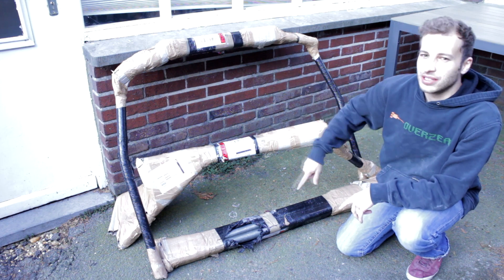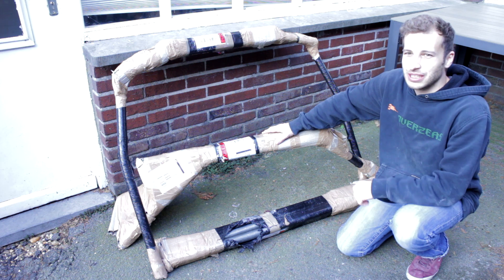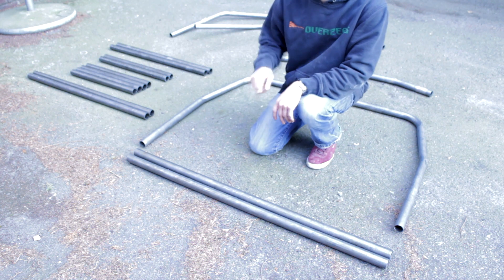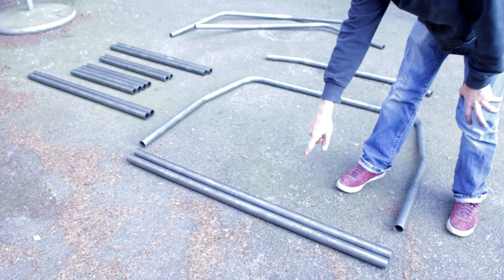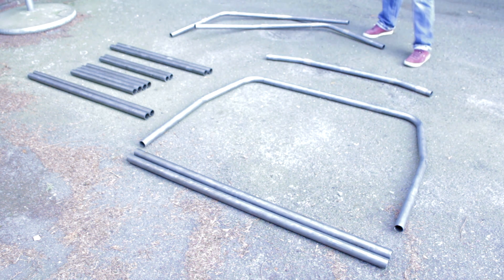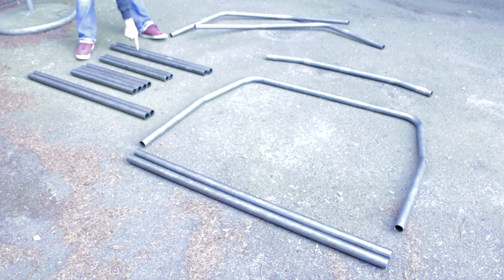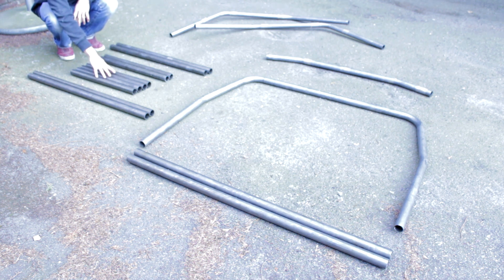I received all the bends for the roll cage. Now we can unpack everything and check if I measured correctly. This is the entire roll cage laid out — the sill bars, the main hoop, the windshield bar at roof level, the two front half laterals, two door bars, the front diagonal in two sections, the front supports, and the pieces of the hoop that go underneath the roll cage to connect the chassis to the sill bars.